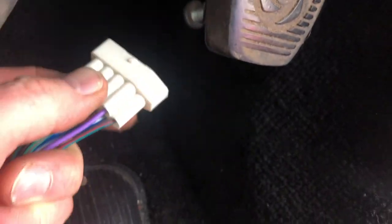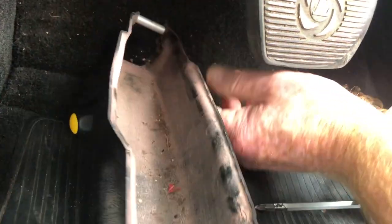Now, to get to the socket which is actually down this long loom here — which looked very straightforward of course when I first opened the box, it's always just plug and play. What that means is you've got to get underneath the steering column and take out this cowling underneath. And that's not only got lots of detritus, spider's webs and various things crawling out of there, there's two little posi-drive screws in there. And at the very bottom there's a bolt and nut with a spacer involved in there, and that actually cradles and holds it up over the top of the steering column. So I've got that out now — sorry it's getting a bit jiggity-pokity with the camera, but it's a bit tight down here for a six foot two bloke. But that's what I need to do now to see if I can replace that socket, fingers crossed.